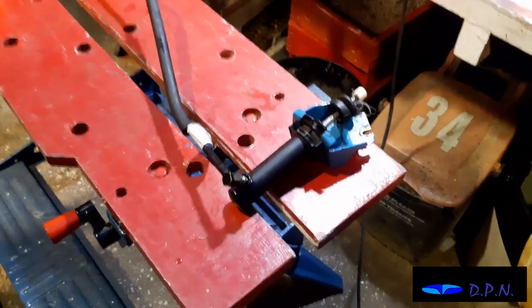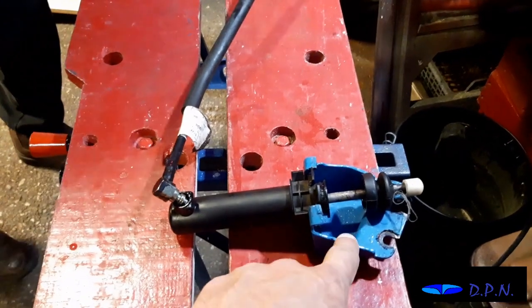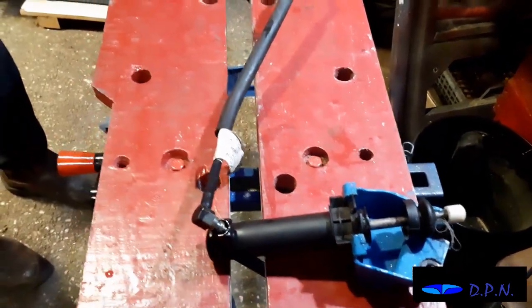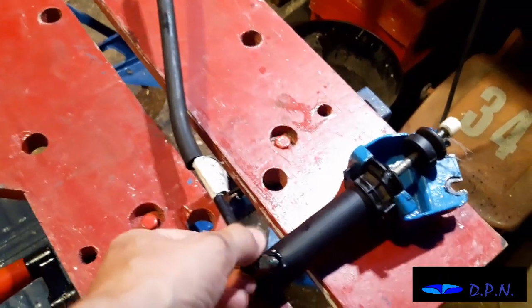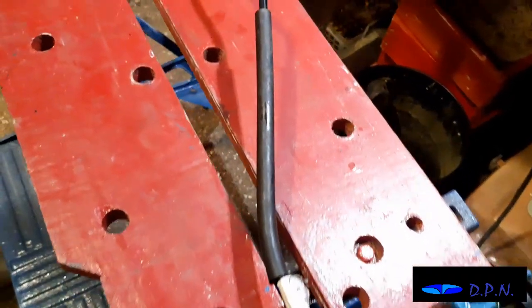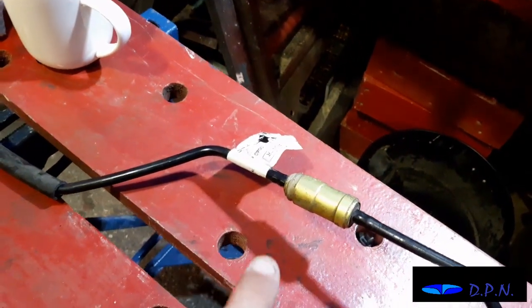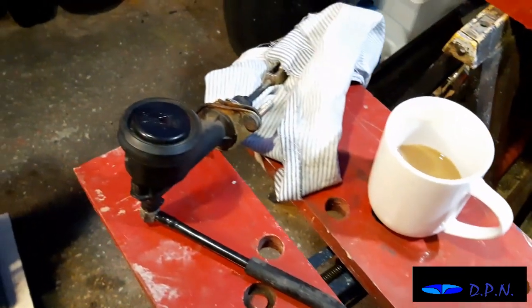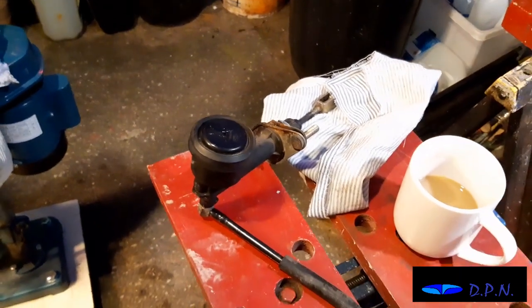So we've now got it laid out actually how it is in the car. I thought this would be a good chance to show, even in the bracket there that it sits in, and how the pipe goes into the slave cylinder there. We've still got it out at the moment, but we will put that back. Again, you've got the joiner there, which we're going to separate, and then the main master cylinder there, which is what we think's gone wrong.